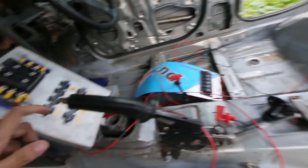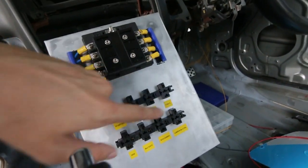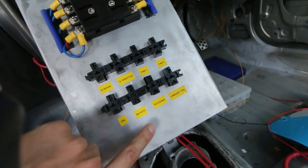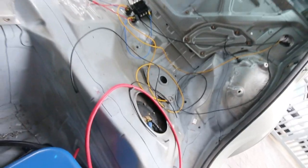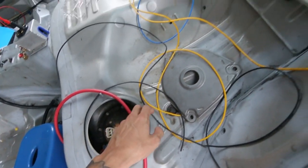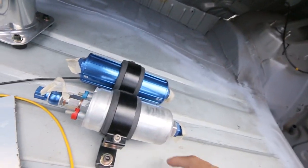I might have done all the power harness. So basically I have the starter, e-throttle, fan 1, fan 2, ignition, injector and VVTi, ECU and dash. A separate fuse box is gonna be behind for the fuel pump, controlled by two relays. So it goes all the way behind. I'll be running two fuel pumps. One is the in-tank fuel pump and another one goes behind, which controls the pump from the surge tank to the front of the car.